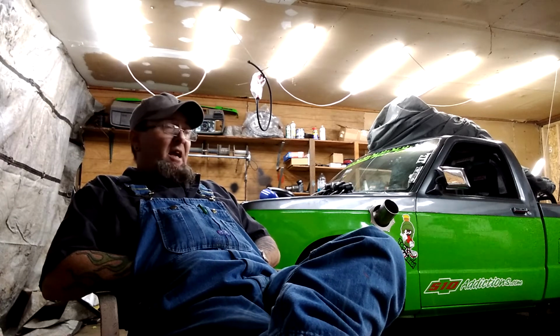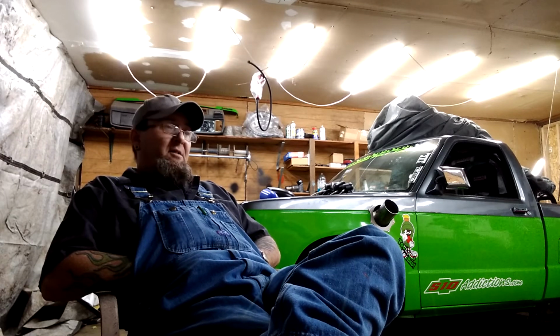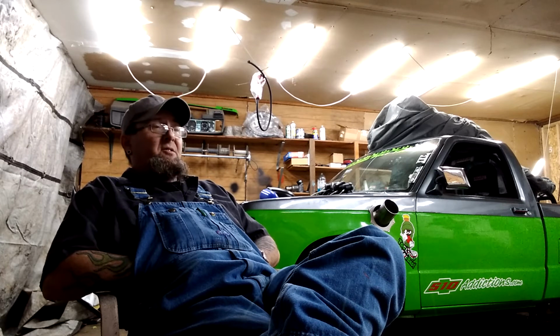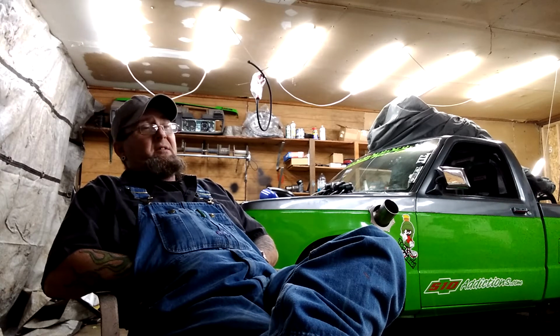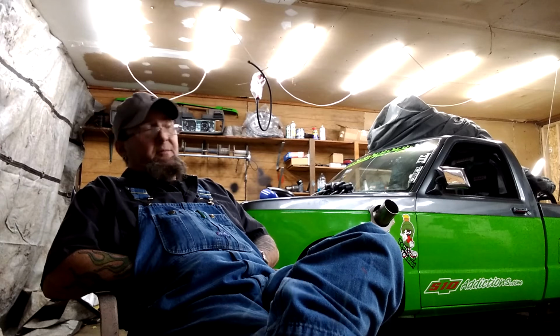Rear end is just a '98 Explorer 8.8. It's been whacked down for an S10. The typical 3-inch chop, which actually ain't 3 inches. You take your axles with you. He'll measure the difference, and that's what he takes out of it. I go to Lane Machine in Kansas City, Missouri. Plus, they'll straighten the axle tubes if they need it.